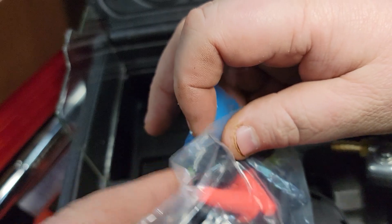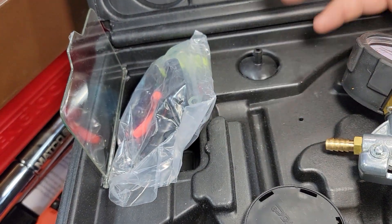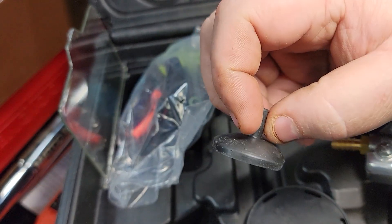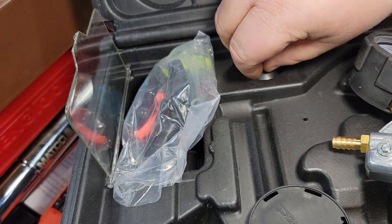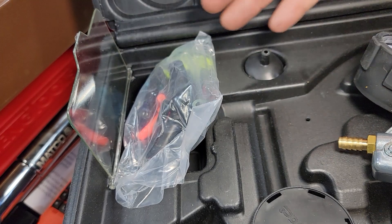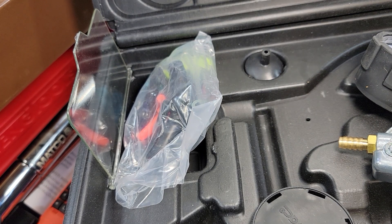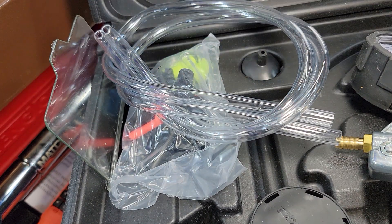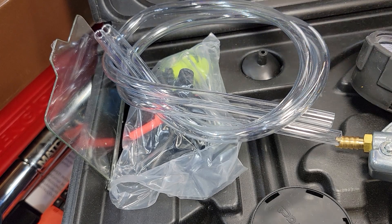The biggest thing is you can put this adapter on for sucking on stuff, pull vacuum on sensors. Let's say you want to check an EGR valve - you can actually hook the hose up to your EGR valve, hook your hose up to one end, bada bing bada boom, and then you can suck on it. Sensor testing is definitely something that's highly overlooked.